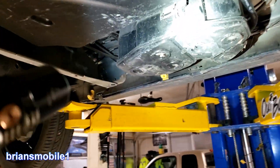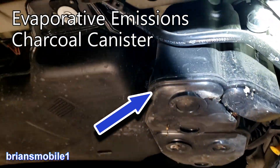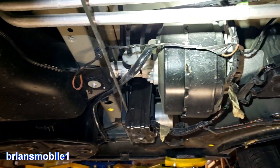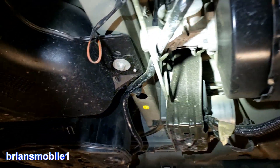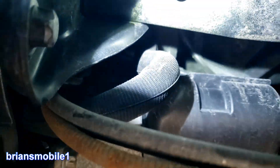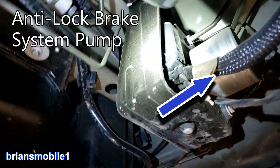The gas tank is down here — this is your fuel tank. It's the whole middle side of the car, with the exception of your evap canister. This is your brake master cylinder, that's your power brake booster, and it does have vacuum — it's a vacuum booster. The vacuum has to travel all the way from there, all the way up over the top, to your intake manifold. This is your anti-lock brake unit.